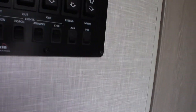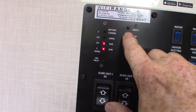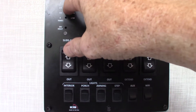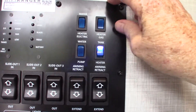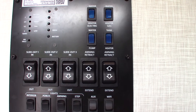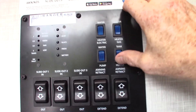This is your control panel. Battery's charged. Fresh water has water in it. You can see black tank, gray one, and gray two. Gray one will be the sink and shower; the black tank is for the toilet; gray two, the galley tank, will be for the kitchen sink. So two gray tanks, one black tank. As it graduates up in one-third increments, they light up. Once you get past two-thirds, start thinking about dumping. To turn the water pump on, remember — that's for pumping water out of the tank or for winterizing. You have tank heaters, so turn that on when it gets cold; there are heating pads on all tanks — fresh water, two gray, and one black — plus a heater by the elbow that goes to the valve.